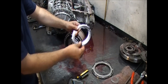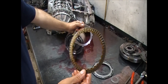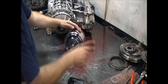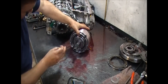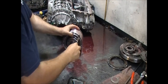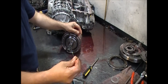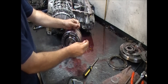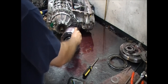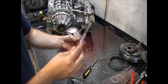We have two reverse frictions — as you can see here, this is a high-energy friction, it's brand new. Now we remove the next snap ring. The opening is right here. This should be a flat snap ring on the bottom, and the one next should be the wavy snap ring — but this is the flat one. Just pay attention to where the snap rings are coming out from, and also pay attention to the position they come out in.